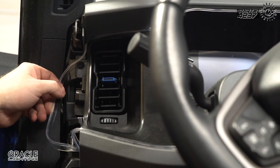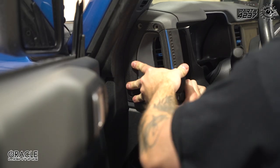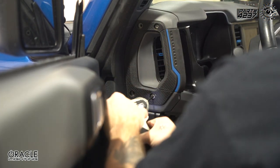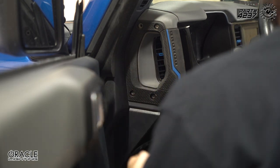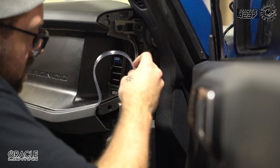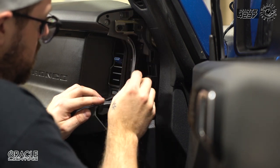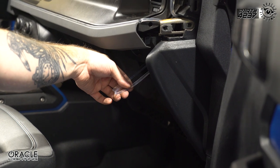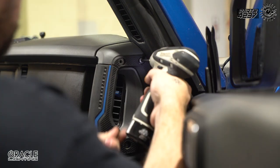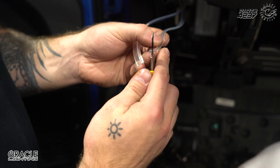Making sure we deal with this bend, we're going to go ahead and tuck this cable down behind the dash, put our handle back on with the T30s back in. We need to tuck our cables back behind the dash and get our handle back in on this side. Now we can move on to the wiring.